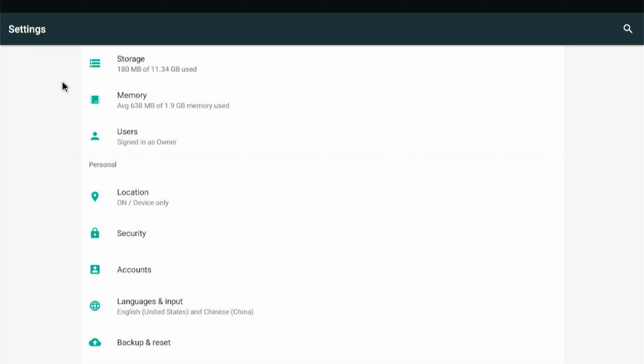And now I want to explain the problem: the new SD card you cannot format on your Windows PC, because Windows cannot handle the file format like that. The Android SD card is a special format. But even if you format the SD card on your HDMI player, you can still read it on Windows. But if you format the SD card on your PC first, the HDMI player cannot read it.